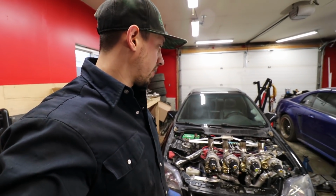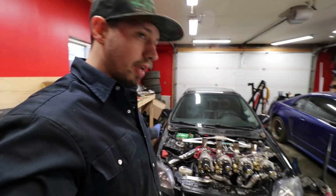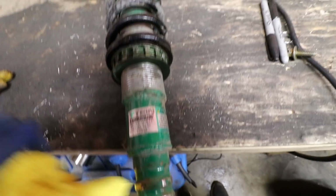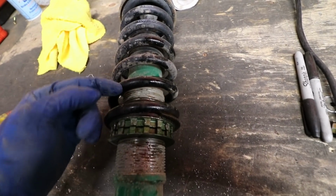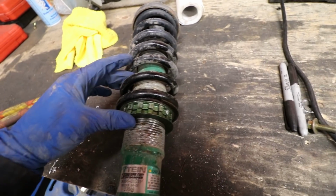So what I think I'm gonna do is pull this strut out. We're gonna try and crank it all the way up. Pull this strut out, do the same thing where we adjusted it a little bit, and then try and crank it all the way up as well. There we go. We have super street dampers. They're actually adjustable on top, which is kind of unexpected, but we'll try and loosen these off, maybe clean up all the threads, and then jack these all the way up to the top. Just trying to make them stiff so we get some more ground clearance.